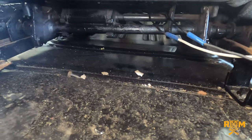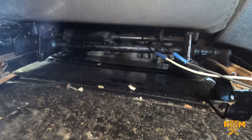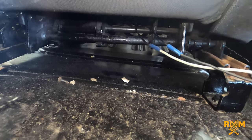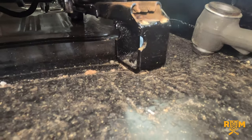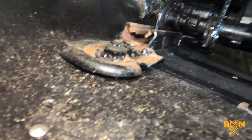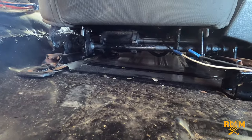I want to show you how these seats were bolted directly into the floor pans and that we omitted one of the pans that's here that's factory. It's a pan I believe is used to raise the original seats so that they end up being at a certain level. In order to fit these seats we needed to have nothing in the way, so we decided to mount them straight onto the floor pan. If you look on this side there is a mount that we had to make in order for these seats to be as level as possible. Towards the transmission tunnel you can see there's no mount — the floor pans have a dip in this direction so we had to raise this side in order for it to level out with the other side.